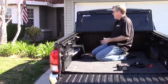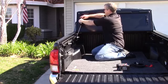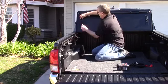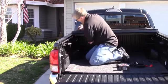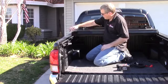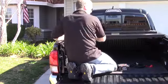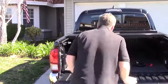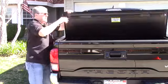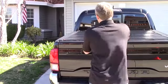We're getting close to finished. Now that the cover is mounted loosely, install the prop rod — there's a little swivel ball in the rail that comes up and fits into the slide lock, securing the cover in the open position. Tighten that up. Make sure the side seal drops into the rail; if it's skewed at an angle, the rail can pull that seal out. As you close it down, make sure the cover is folding squarely in the opening, with the side seal dropping right inside the rail. At the back, the half-inch thick solid panel needs to drop inside the tailgate, so we've left it loose to make that adjustment.